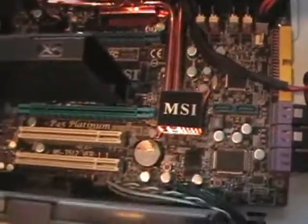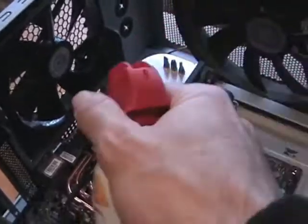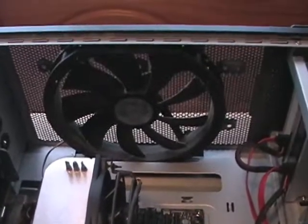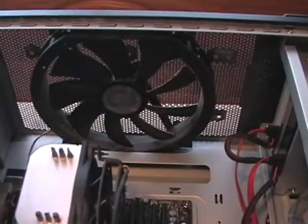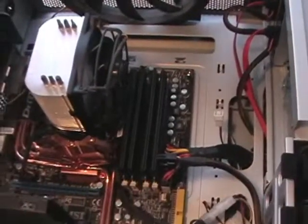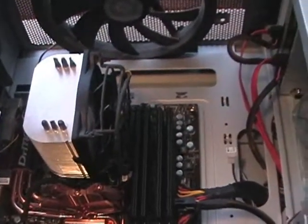It's actually not bad in here. I do maintain the inside of this case pretty well. You pay a lot of money for all these components — the last thing you want is your computer breaking down because of overheating due to dust. The fans can slow down, break, or have dust buildup that throws their balance off. You're spending all this money on parts — all it takes is just a few minutes: open up the case, take the side off, give it a quick dusting, vacuum out any dust bunnies, and you're all set. It prolongs the life of your computer.